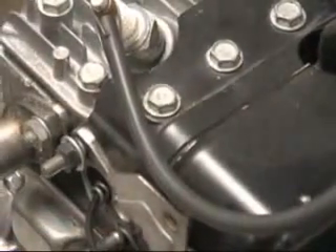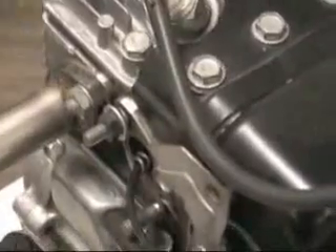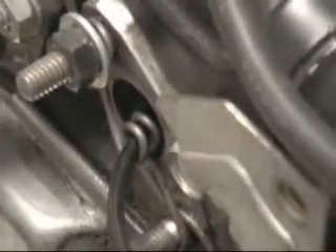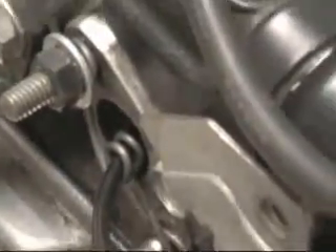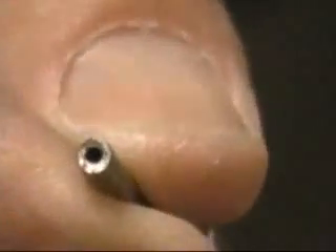The orifice is about a sixteenth of an inch at the point of entry, but you can do with even a smaller orifice. This is an example of the size of orifice we'd use for delivering the hydrogen at the intake port on a very inexpensive conversion.